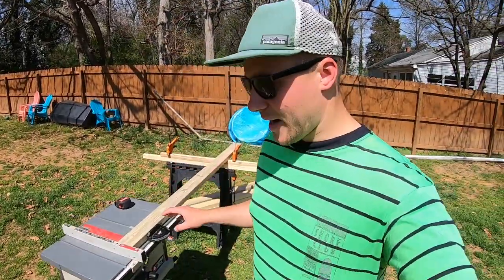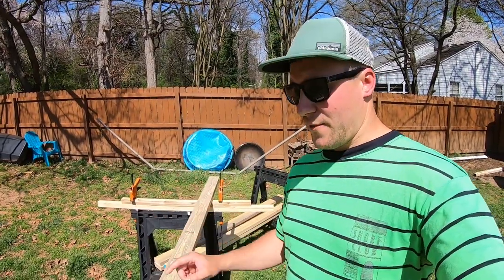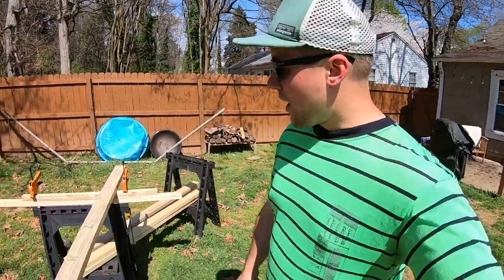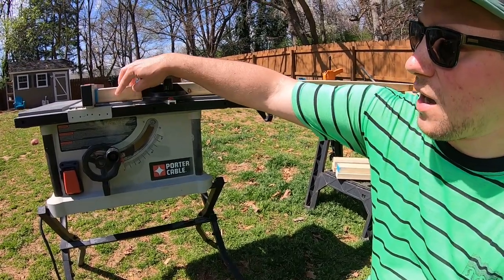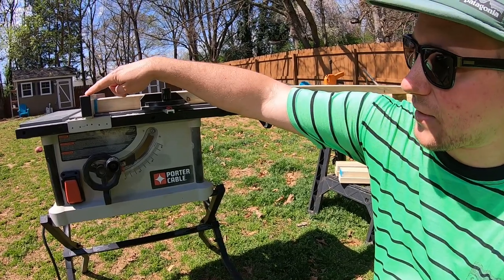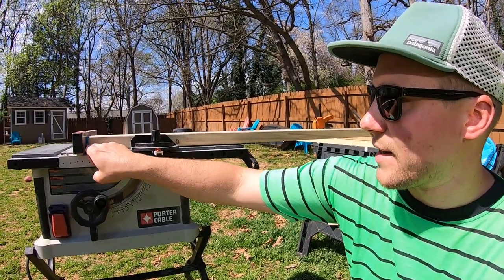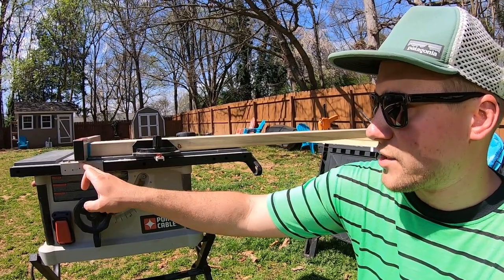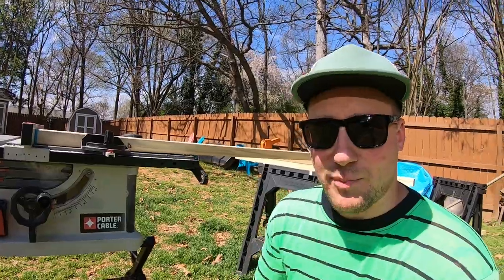I'm getting the paint all set up. I decided while it's drying, I'm going to notch out our bed frame. So these are the two-by-fours that will run across the van. We have five of them to try to distribute the weight, and then that half-inch plywood. Two-by-fours are an inch and a half — not two inches. So I set the saw blade three-quarters of an inch, and then I set the guide to cut an inch and a half in. So we'll have basically a notch three-quarters of an inch up and an inch and a half over. That first cut will just be a cut and then I'll change the guide an eighth of an inch and keep going further and further out. That way, once we get to the end, it'll be pretty flush — just little pieces that I'll be able to sand off. I'm going to go ahead and paint the boards, and once those are painted, go ahead and start notching those out and then keep going back and forth until we feel good. Let's do it.